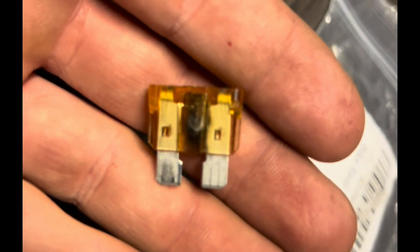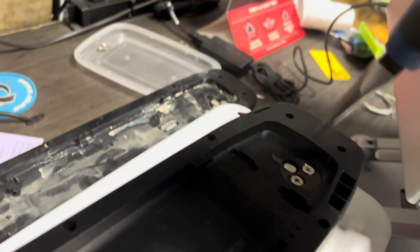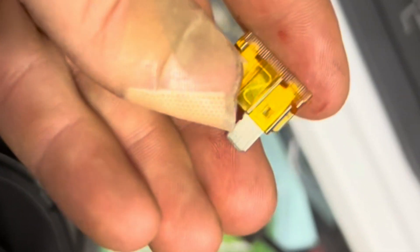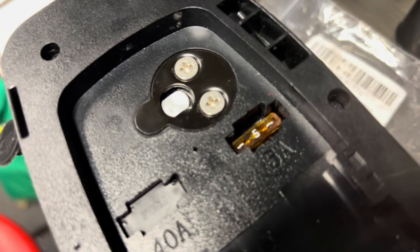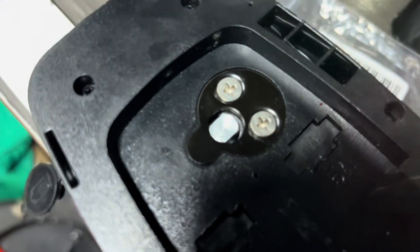This was the blown fuse and the cause of that issue. Once that cap is removed, we're just going to take some needle nose pliers — or if you have a fuse puller that works a little bit better — and use that to go in there and pull that fuse out. Now we're ready to put our new fuse back into that five amp slot. Push that into there, use the pliers to give it a good grip, and push it back down into the full seated position. Now we're just going to use that little fuse cap, put that back over the top, and push it in.